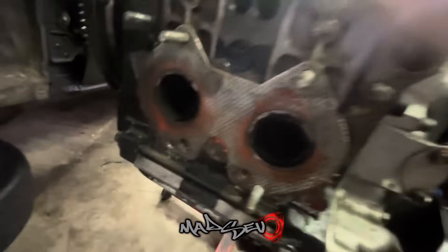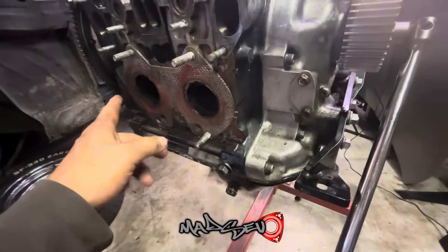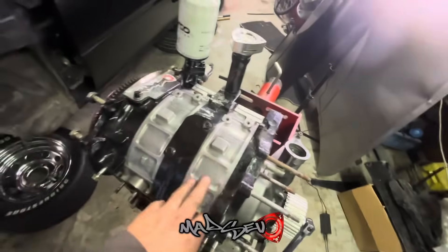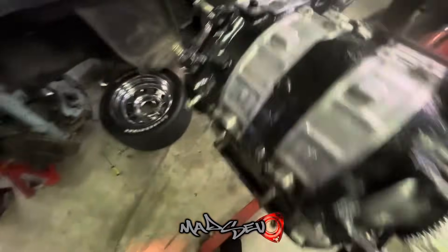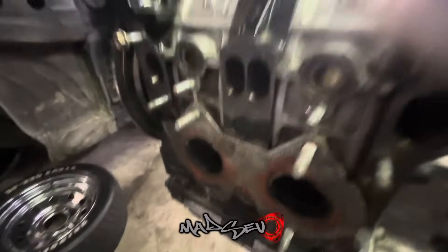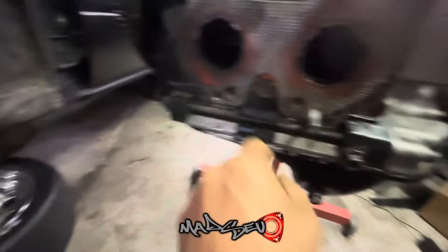Nice little 12A bridgey there. There is water coming out of the rear housing so there's a water seal issue. Apparently this engine was built dated the second of '06, so it was built 19 years ago, and as far as the owner is aware it hasn't been pulled apart since. Turning the engine over it doesn't sound too bad, but he has issues with it starting - needs a lot of fuel to start.